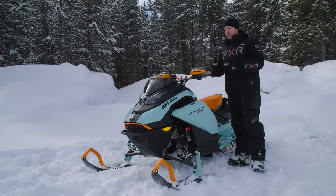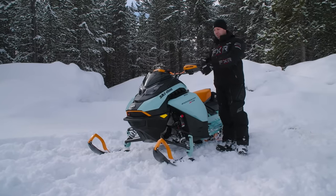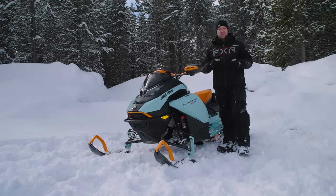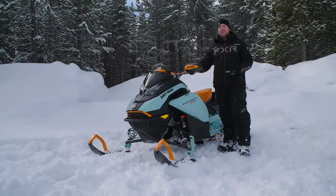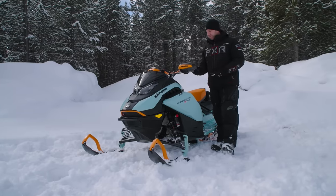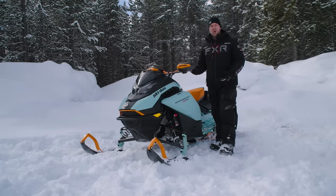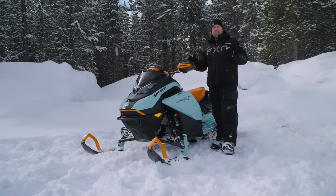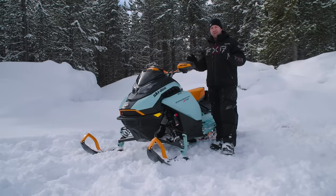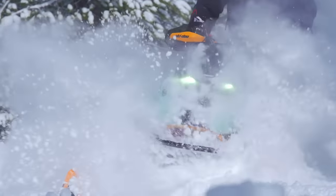One of the nice things about G5 is that super refined reduction in vibrations — no more hand guards flopping around like crazy, no more handlebars vibrating. The other good thing is that this has the rack steering system in it, so when I wiggle the handlebars there is almost no play whatsoever. No notchiness, no bumping — when you put a small input into the handlebars you get a small output at the skis. Very precise, very refined, works really good.